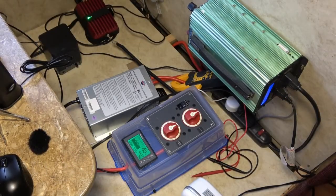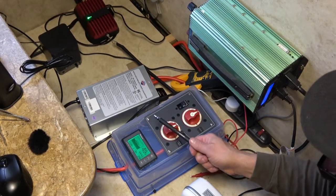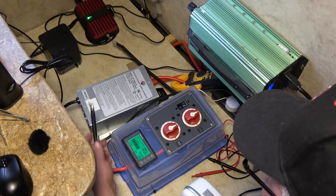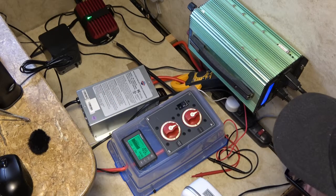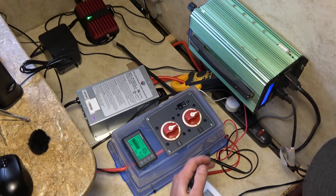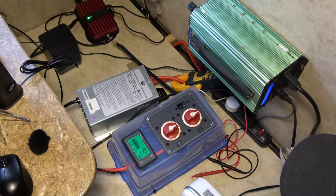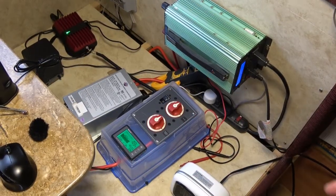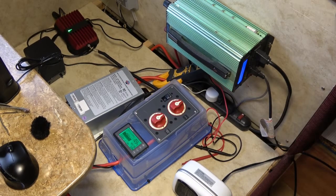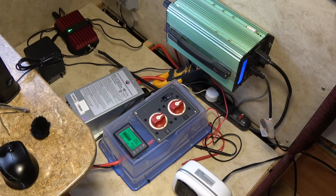This is not the normal way you're going to mount this device, but once you get her mounted underneath the cabinet it's really hard to test what's going on. So I got myself a little station set up here with the power converter. And underneath this bench are two 100 amp hour lithium batteries that I'm using to test this device. Basically what I've been doing is running them down and then bringing them back up to see how this converter performs. Connected to the batteries is this 1,000 watt inverter, and I have a little 250 watt heater that I'm going to run off this inverter so that it can pull power from this converter to see how it operates.